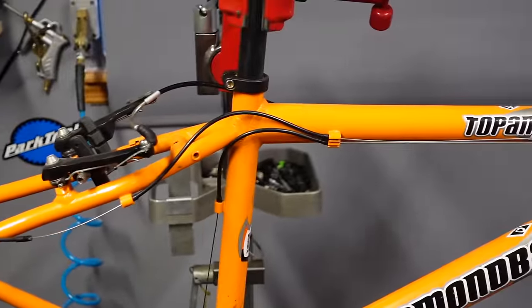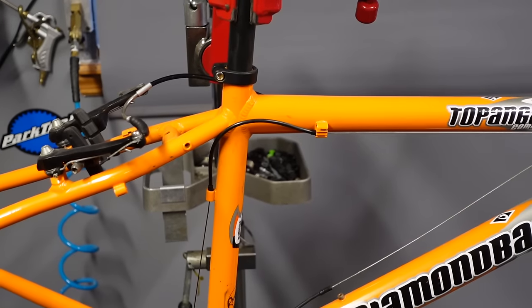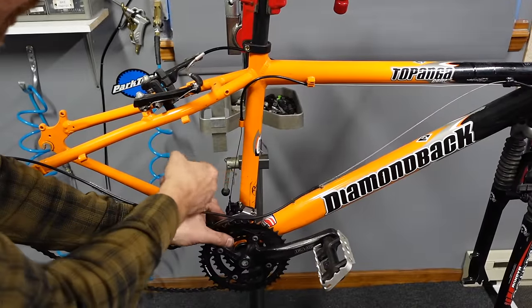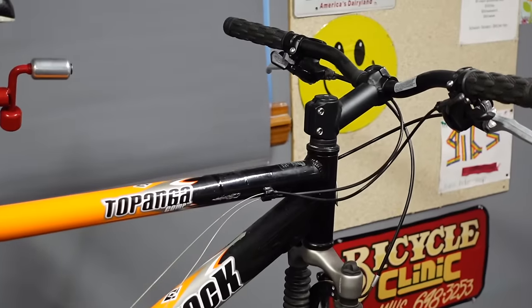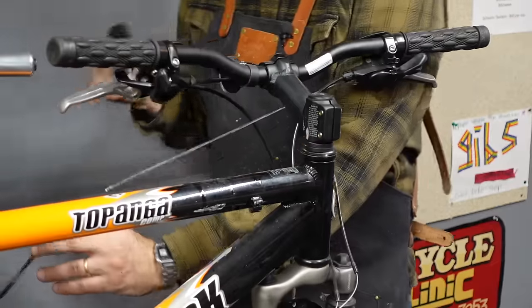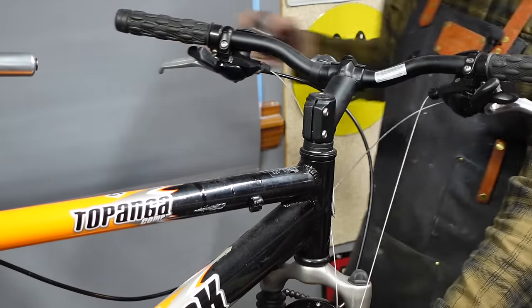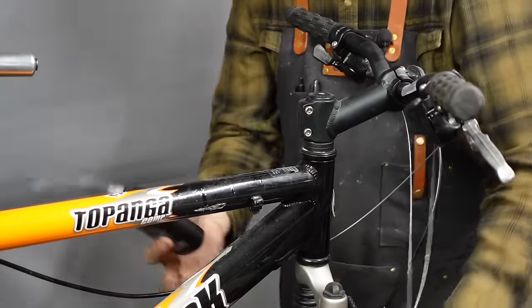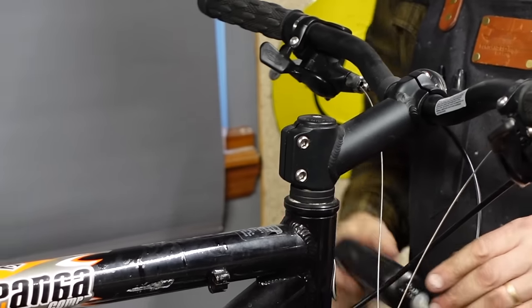But we don't stop there. We'll go up here and disconnect this and disconnect that. Then, with the front derailleur in its most relaxed state, you can pull it out — that gives enough slack where you can disconnect that one too. Moving to the front, take your bottle of lube, disconnect all your cables, and we just find our cables and put some tri-flow on them. A little dab will do you — just a couple drops along the way. Drop some down the front brake cable here.